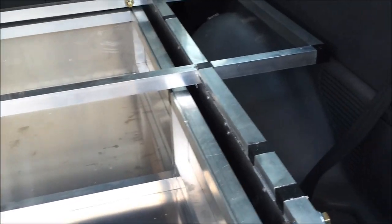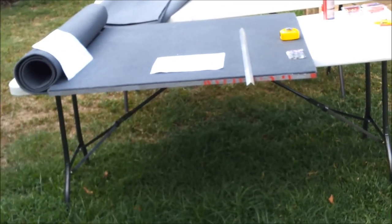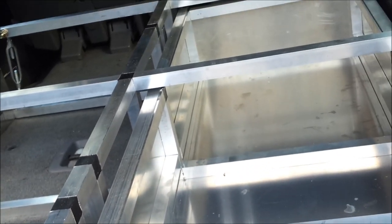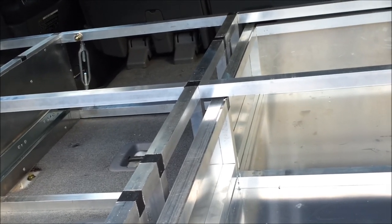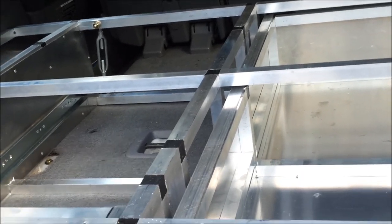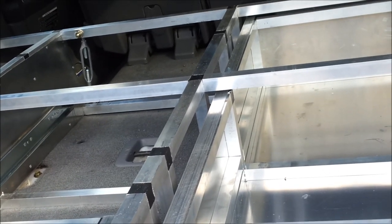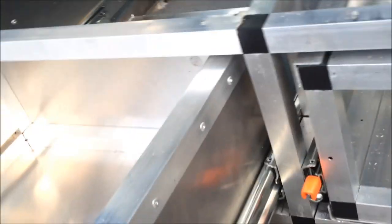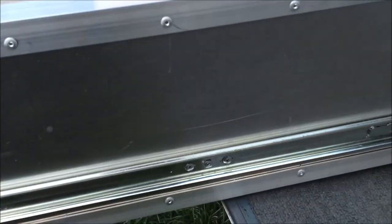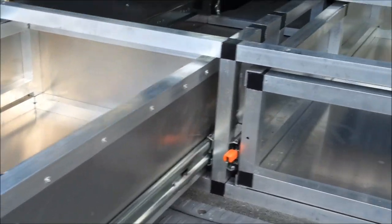The two issues I had with steel and welding were that you have to square it all up and it takes a lot more time — and it's also quite heavy. The aluminium is a little bit more expensive but not much more, and it's quite strong, especially when you put the sides on. I've riveted everything together using angle on top of each drawer. These drawers with the pull-out devices pull right out so you can take them out and clean them. I'm going to carpet inside them so things don't roll around and make noise when travelling. I hope this has been helpful — we'll see you later.